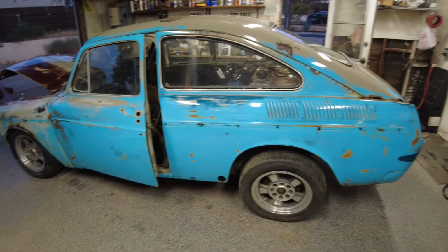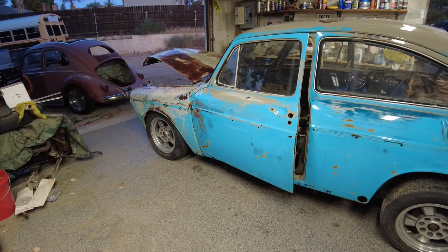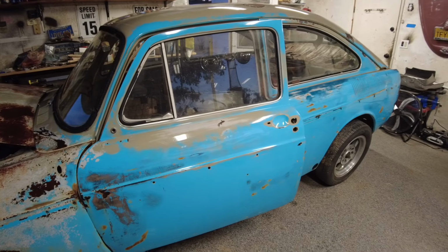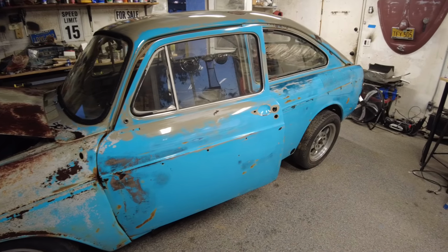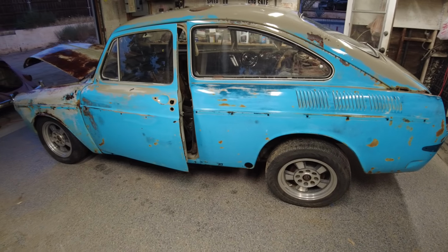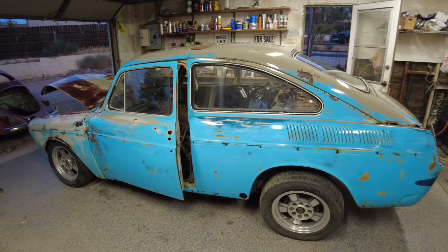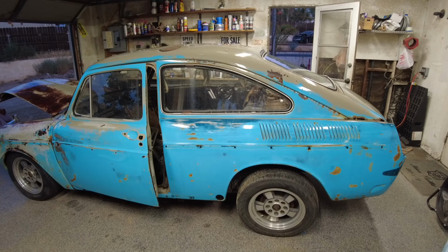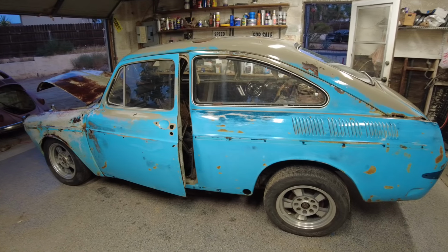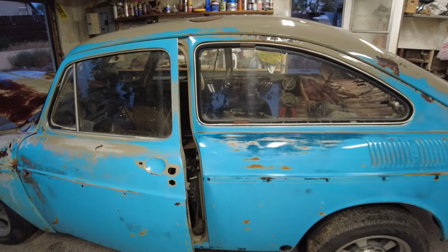Like I said, it is a true clear coat. It's not one of those sauces that you have to reapply. It's not a linseed oil that will stay sticky. This will dry. And you can wash the vehicle like normal. You could go over it with your Meguiar's Instant Detailer. You could treat it just like a regular paint. Or you could ignore it and leave it like a stepchild. Either way, to me, it's a great alternative to a lot of the other stuff that's on the market, and leaves a great finish. It's easy, user-friendly to apply, and reasonable. A lot cheaper than some of the other brush-on or hand-laid-on clear coats that are on the market right now.